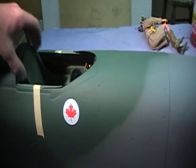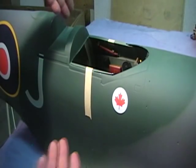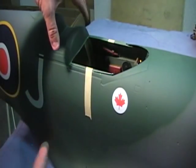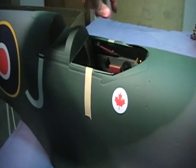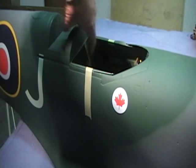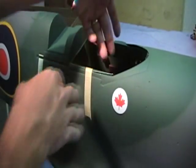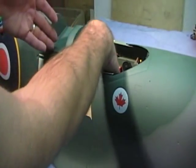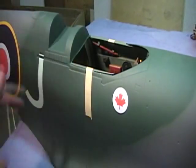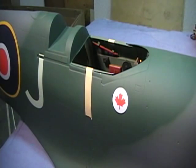The only other thing you have to do is — there's a piece of ABS supplied. At the back, take a piece of paper, lay it in there, trace it, and once you have that template, bring it up to just over this edge, because the seat covers up 90% of that area. Trace it inside, cut your ABS out, then come in from the back side, slide the ABS in, and glue it up the edges to lock it in place. Paint it afterward. There is a big enough piece of ABS to fit the whole area. Once the dash is glued in and the back is glued in, it makes a really nice strong box.